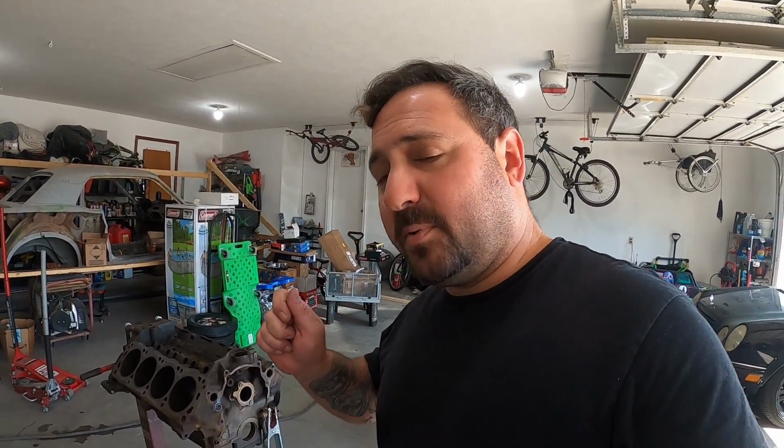Plus, when you weld on it and you put all that heat in the bolt, it kills all the rust. That way it frees up the bolt. Spins right out. Just fair warned, hot, hot, hot. And also, when you go to break it free, slow, steady pressure. Don't try to jerk or hammer that thing. You'll just end up breaking it off, and have to do the process all over again. So, next clip.